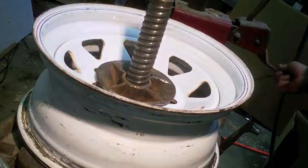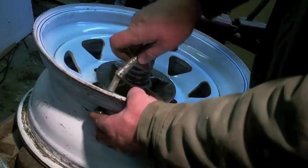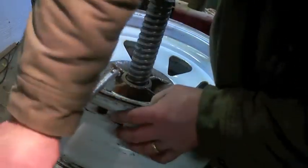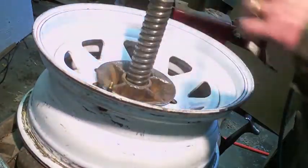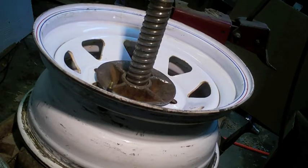These rims were the ones I had on the truck when I had that disastrous string of tire luck two years ago — I think both front tires went within 50 miles of each other. You can understand why I felt I should probably not run the rear two anymore, even if they looked okay. I believe these are American Racing — your classic white spoke steel rim, about as cheap as you can get that'll fit the Dodge. They don't self-align on the hubs; they align on the studs, so they won't hold as much weight as factory rims which align on both the studs and the hub.